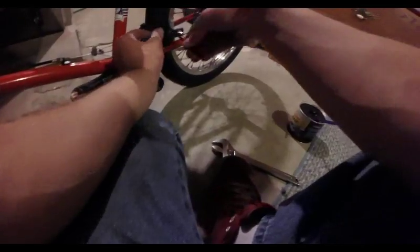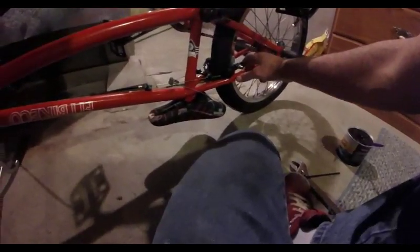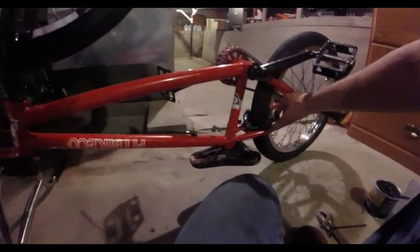I'm not sure what's wrong — I'll go ahead and double check. It's possible that my spring isn't in the right way or something. That spring should be plenty tight like that. It goes in and it's springing out a little bit, and it looks like something is interfering with it. I'm going to have to look into this and see exactly what's wrong. It looks like I do have them adjusted the right way; it's just that one side is getting hung up on something, so I'll have to pull the brake caliper back out.